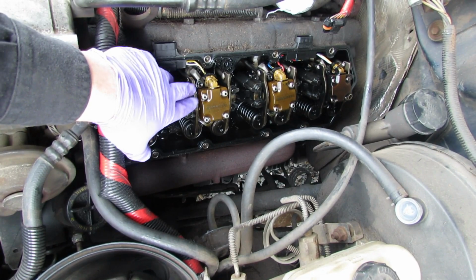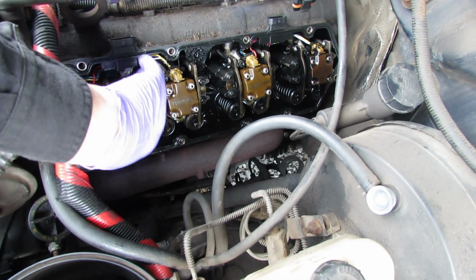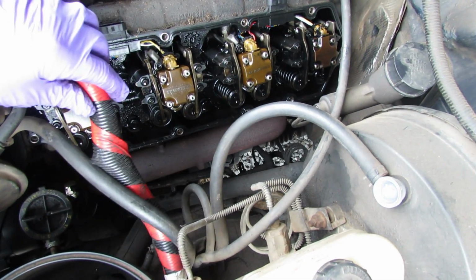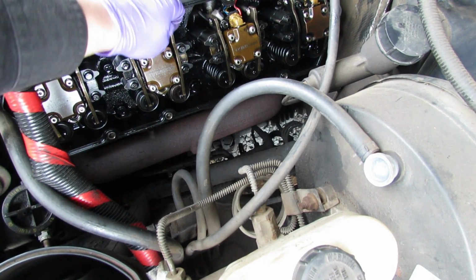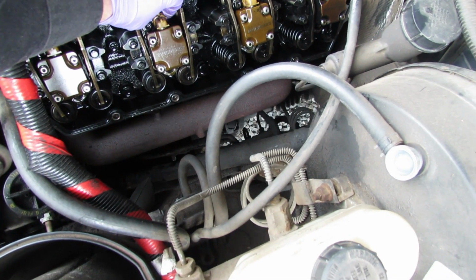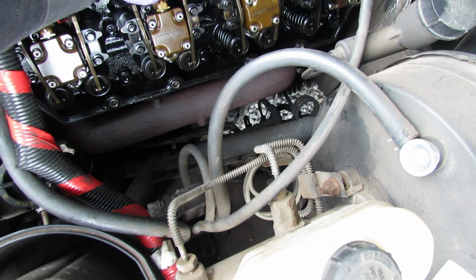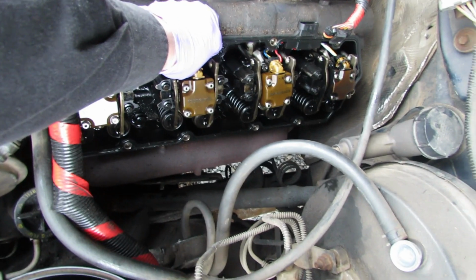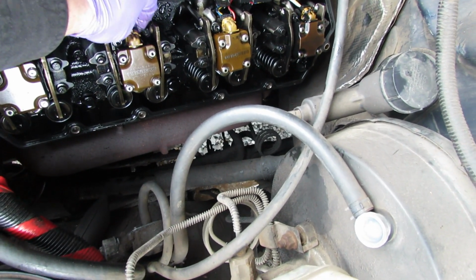And then you have to unplug the glow plug, which is underneath of there somewhere. So you can see once you unplug it, unclip it, it just unplugs. And then here's the glow plug wire. Oh, there we go. Here's the glow plug wire right underneath of that little clip, and that just pops straight up off of there.